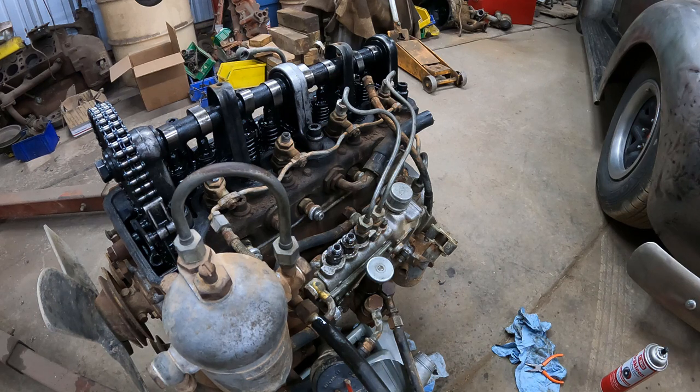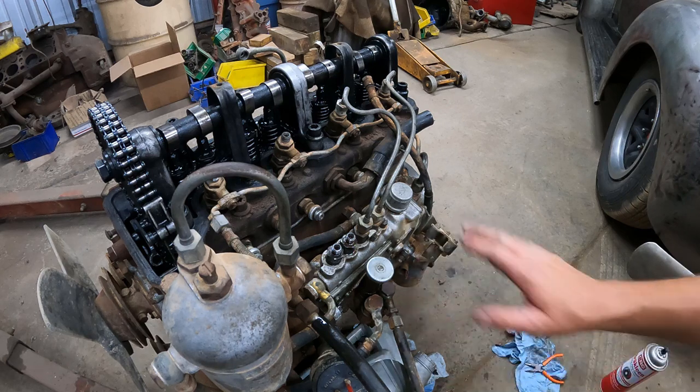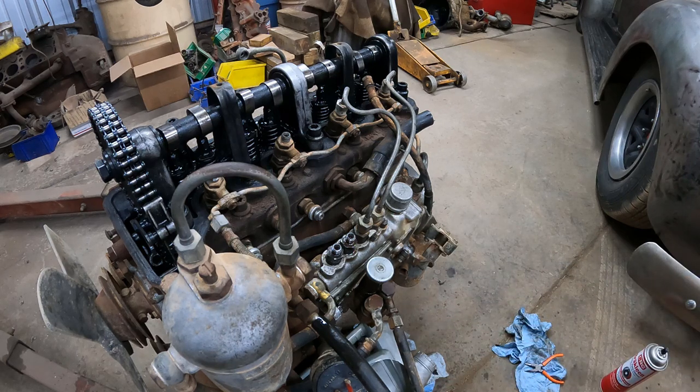So that's basically timing all the inline pumps on a Mercedes. Sometimes they have a little different instruction, and you need to research what is your timing. The OM621 is 26 degrees before. Most are in that range somewhere, and that's about it. Hope this shows it a little better than in the car.